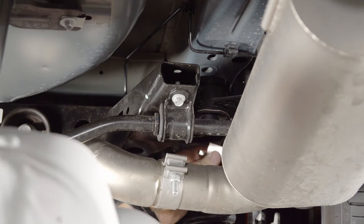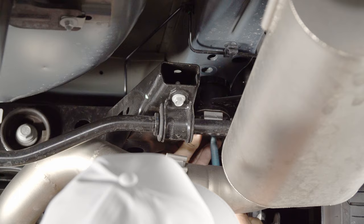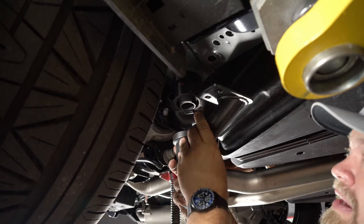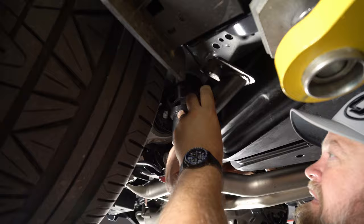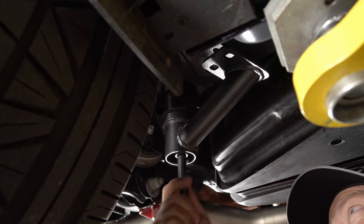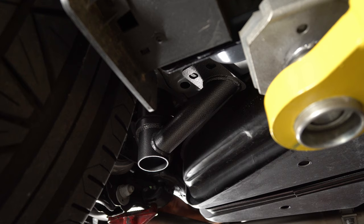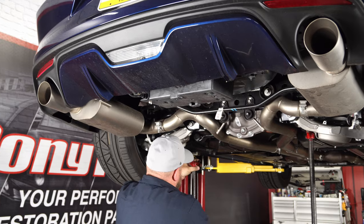The other piece is going to go on the bottom. Grab the bolt and just thread it back in by hand. Up here on the front, grab the thicker bushing, place it on top, and just press it down. You want to grab the lockout and put it in place — basically the holes go towards the outside. Just get the bolt loosely started, then tighten it up until the subframe touches the frame again. Back it off just a little bit so we have some movement in the subframe, then repeat the process on the other side.